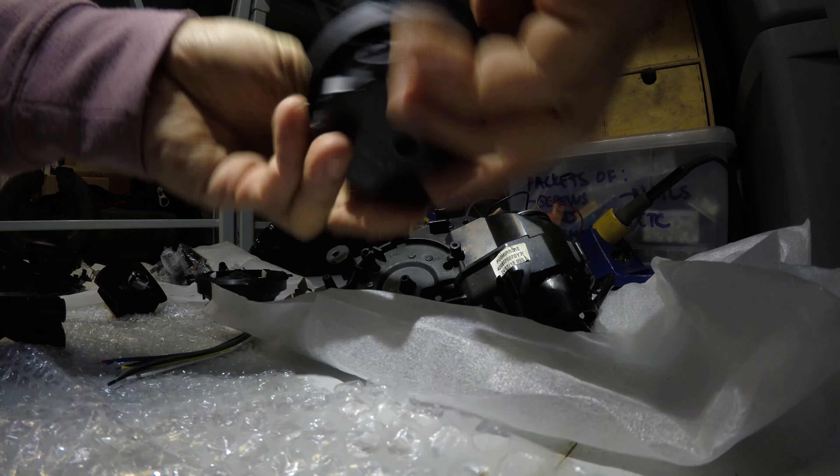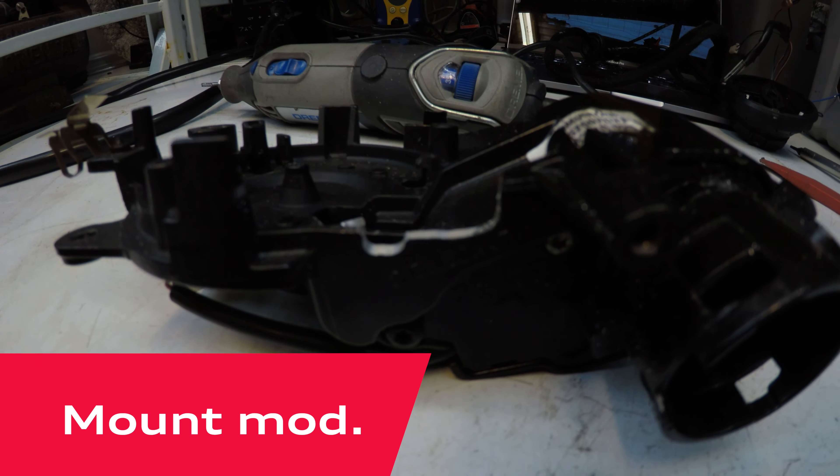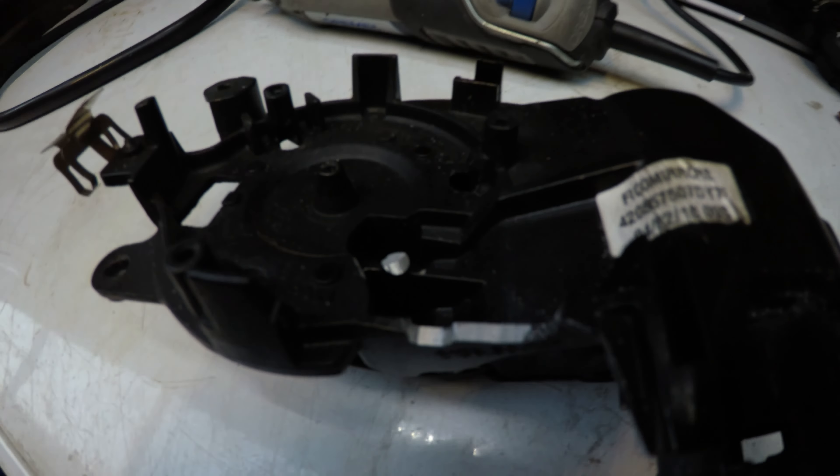Here's the major difference between the two motors. On the left is the memory or reverse mirror dip motor with 8 pins and a square plug, while the basic motor only has 3 pins and a flat plug. I tried attaching the reverse dip motor without any trimming of the mount but clearly I needed to trim the bracket as the plug needs clearance. Here's my first round of grinding the bracket. In the end I needed to take that lower notch all the way across to the right, and once that's done just paint it with black acrylic paint and let it dry.